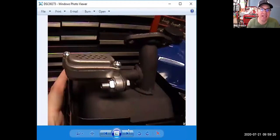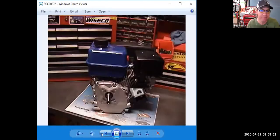And then this little silver looking box on the bottom, there is a better shot of it. That's actually a pulse air injection system. What it would do is take fresh air from outside through these little vents and suck it into the exhaust and then into the cat to help the catalytic converter burn up the emissions. It was pulling fresh air in, mixing it with the exhaust, and keeping the burn going to burn up all those hydrocarbons, use up the carbon monoxide, and get everything turned into carbon dioxide, or CO2. So I had a catalytic converter and an air injection system.